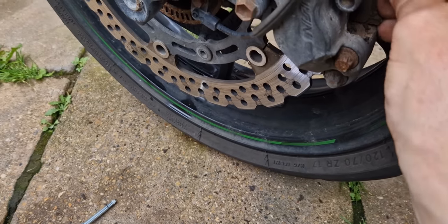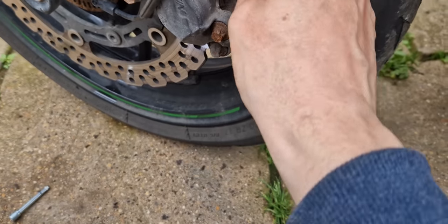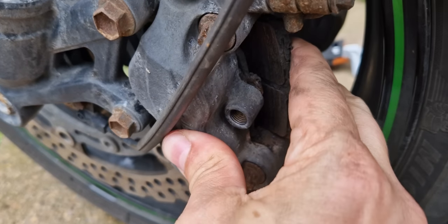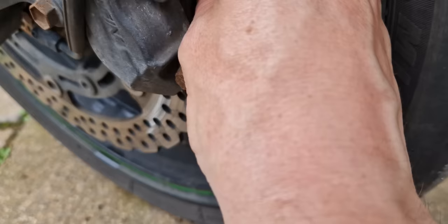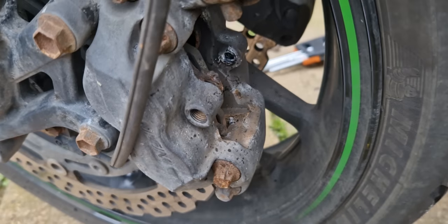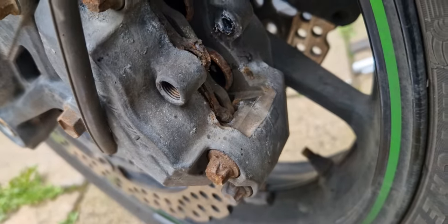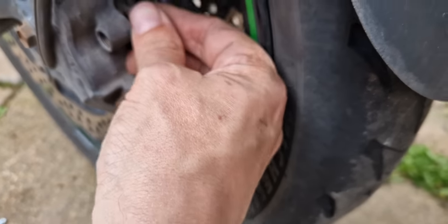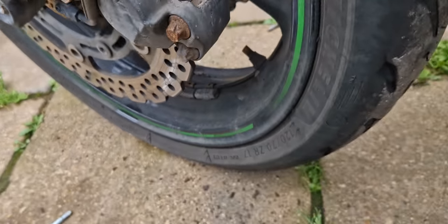There - I can push that back in by hand, you see. When you do that, pull - see, I'm doing it with my hands. If I'm doing it with my hands, hands are weaker than metal, I hope. And that last bit there, there we go. Our pistons are all right, and you can push them back in with your fingers. The callipers are fine - the callipers and the coatings have done their job. This is just all staining and scratching and crap. They're actually fine. The pistons have got rusty edges but the important bits will be fine.